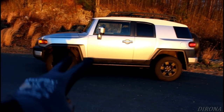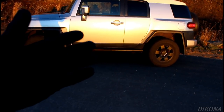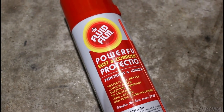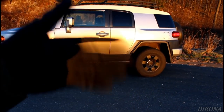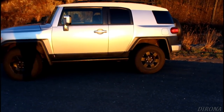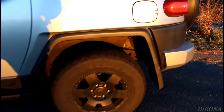The second thing I do is give the bottom of the vehicle a real heavy coat of protectant. The stuff I use is called Fluid Film. It's gained a lot of popularity in recent years, and for good reason because it is excellent stuff. It comes in a spray can, or if you have a 30- or 60-gallon compressor, you can get an air gun and paint it on that way. It's basically just a lanolin-based oil, so it's environmentally friendly.